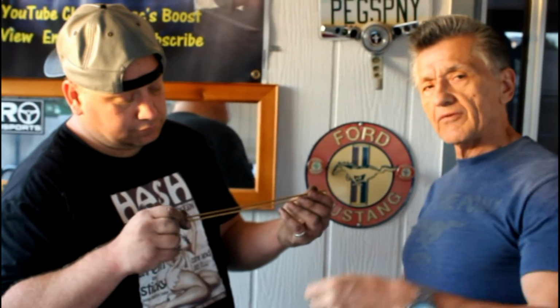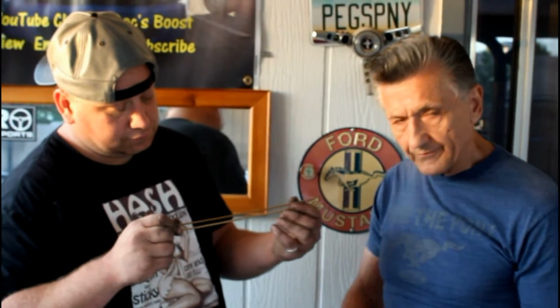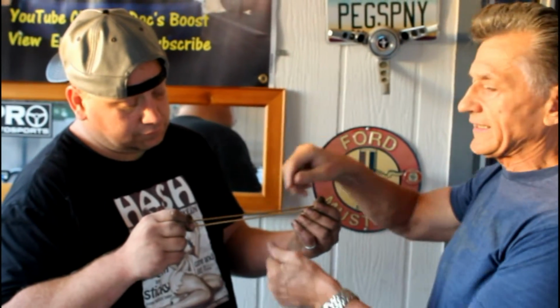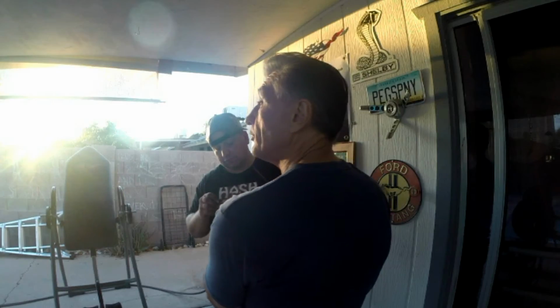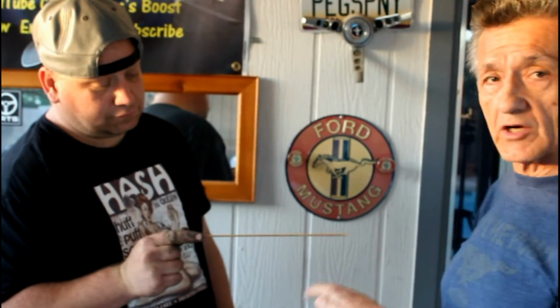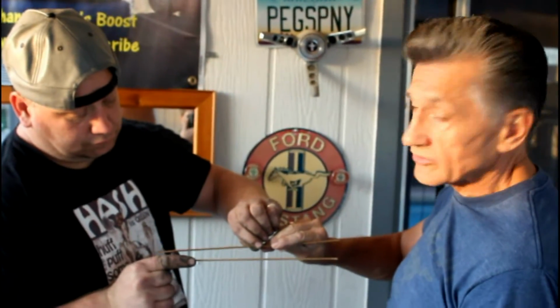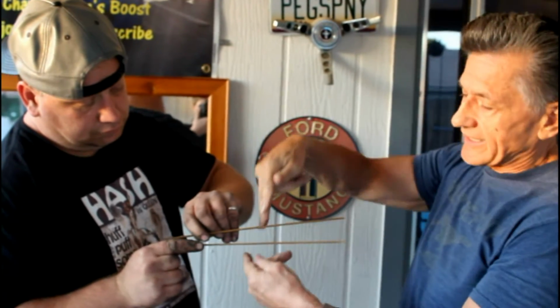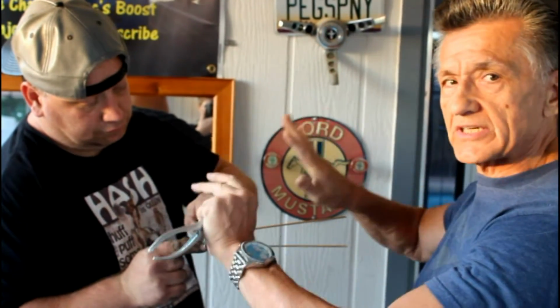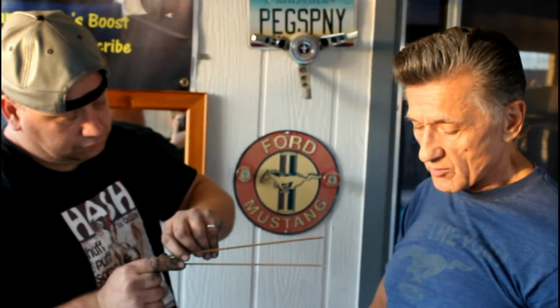Now, before we get back to the video of how to do this job, it's probably a good idea to understand again how you put it together once you come back to this point. So, you find the rod that stays there molded into the seat back cushion. You're pulling down the seat cover, and when that happens, you get close to the same point. When you connect these two, it keeps the seat cover and the seat cushion kind of streamlined and tight. So it's a nice, clean, smooth look.